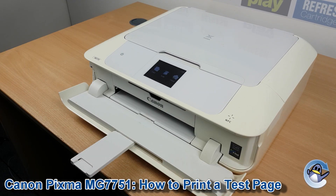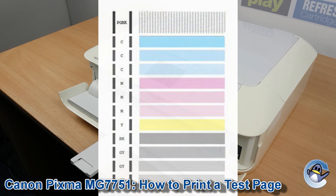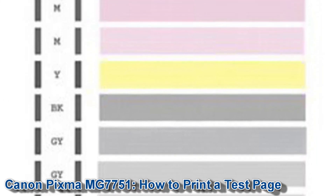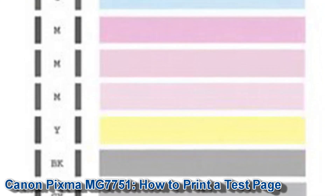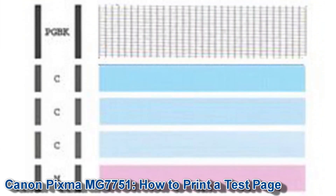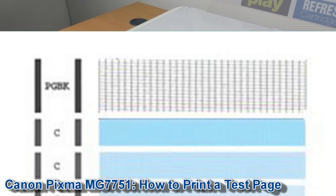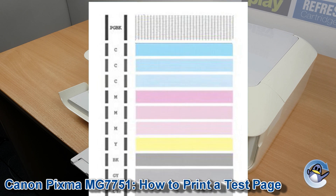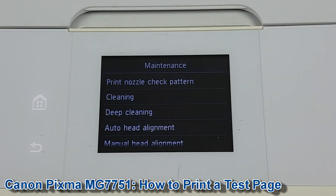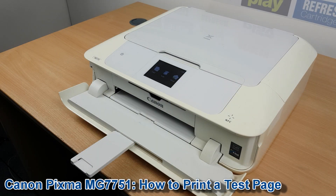The results from this printer aren't looking too great, but you should be looking at something a little more like this — with a breakdown of all the different colors your printer uses, showing its ability to print solid blocks of color at various levels in these bars, and for the main black cartridge, its ability to both print in black and also produce fine lines, since it'll mainly be used for text and detail. Using this you'll be able to get a pretty good idea of where the issue lies for your printer. If you spot any issues, I'd recommend doing cleaning or deep cleaning, which you can find on the previous menu — and if you're interested, we have a separate video on those two processes on our channel as well.